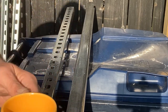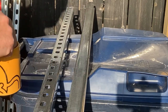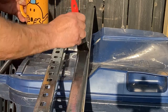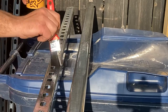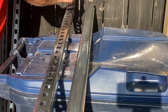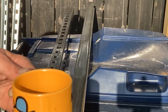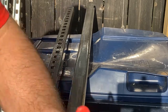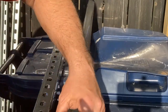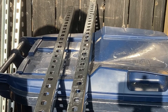You don't need much — one application does the trick. Then this is ready for powder coating in my case, but you can also paint it with normal paint. If you tried to just spray this without T-wash, your paint will come off. I've seen it happen.